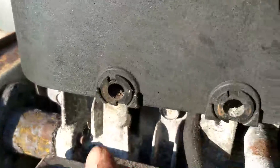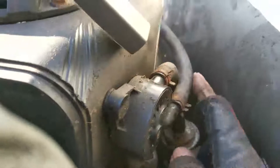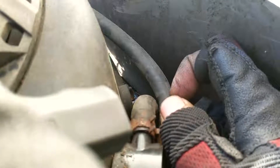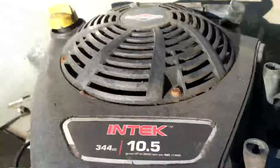You're going to find two bolts in the front here. If you come around back to your fuel pump area, behind these hoses there's going to be another 10 millimeter bolt. And if you go around to the other back side, there's another one right there as well.